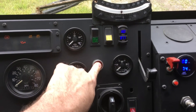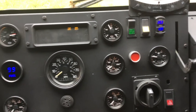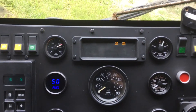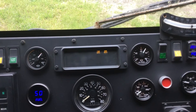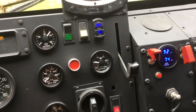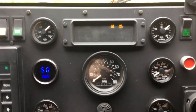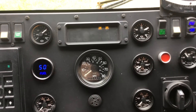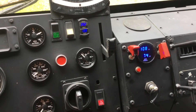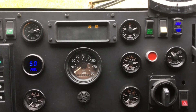Starting it up — the low pressure light's out, the low pressure gauge is up, and fuel pressure is at 20 psi. The systems were low enough to kick the compressor, so the compressor should be online now. You can watch the air pressure rebuild, and you can see it building in the wet tank as well, as it refills the wet tank and the primary and secondary tanks after those couple of brake pedal applications.